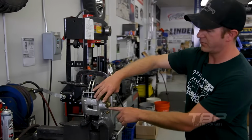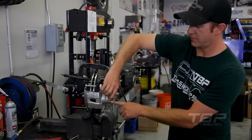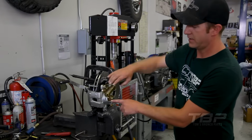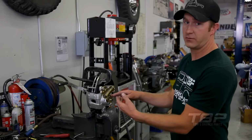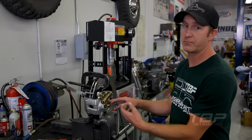And it's critical that when the caliper is adjusted properly, when this lever is rocked forward and the e-brakes are tight, there's no more than about 1/8 of an inch gap here. If that is not done, or if it's not adjusted properly, you will have too much pedal travel while you're driving the vehicle around, and then the e-brake won't have any grip to it either.